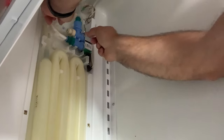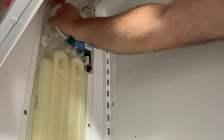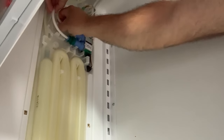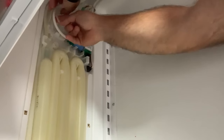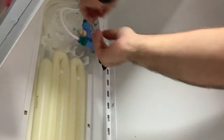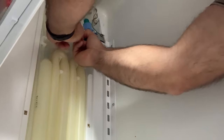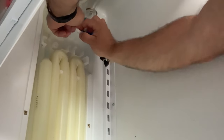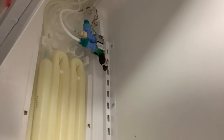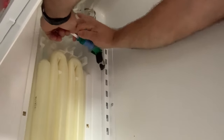For starters, we're simply going to unlatch the plastic tubing here. We've got all these tubes that are connected and we've got our solenoids here — you can see green on bottom, brown on top. We're going to go ahead and separate the white tubing here, make sure we can get that one out of range, and then the plastic clear tubing there. We've got this other tubing right here that also is kind of wedged in there. We're going to separate that, and now our whole contraption is out. We simply need to push in and pull out — that white tube is on bottom, so we're going to go ahead and pull that one out.